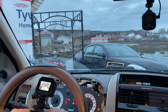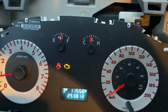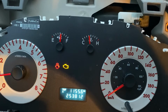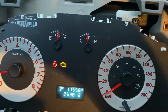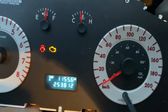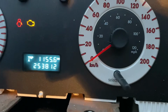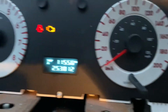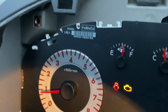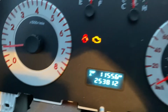She will do all kinds of funny things here now. See, my gas gauge now is correct. My temperature hand is correct. I know this vehicle. I know how it operates on this temperature. I know when it's completely warmed up, it's been driven for a while, she's always in that position on her temperature gauge. And her speed is exactly on zero now. As you could tell, it wasn't before. And my RPMs are idling just a little bit under 1,000, which is our normal position.